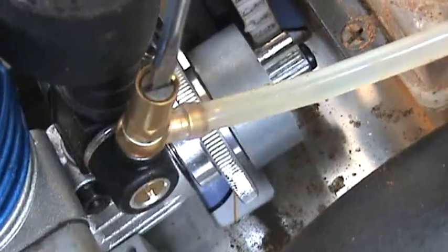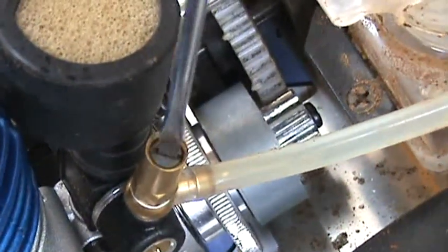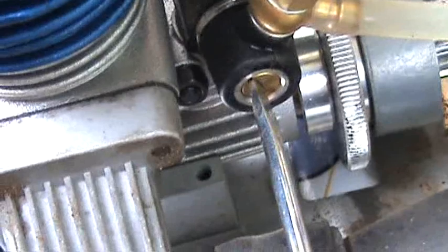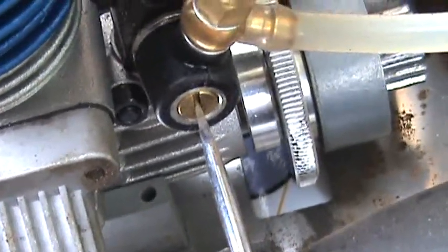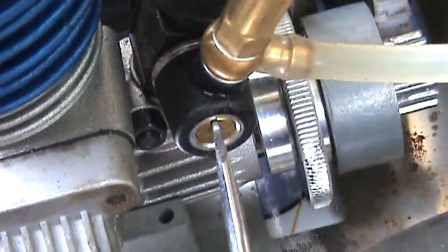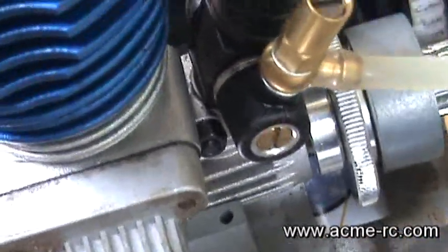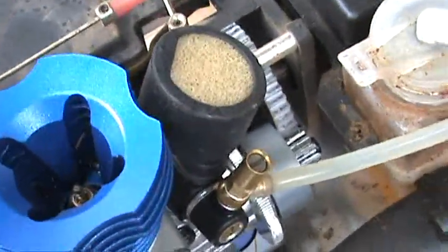Once again let me show you the settings. For the high end, flush it to the edges and then one, two, and three turns clockwise. For the low end, flush it to the edges, then when I looked into the carb I saw the gap between the two needles and set them to about 1 to 1.5 mm by closing the low end one full circle. On this setting the engine is running very well — kind of perfect. I would even go out and bash it, but it's the rainy season so I cannot get the truck out.